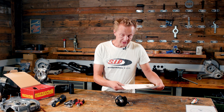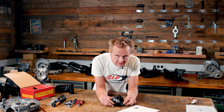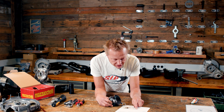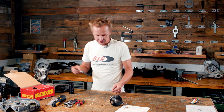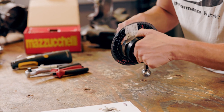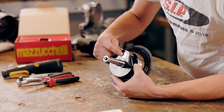If you go on the internet and look for a crankshaft for rotary valve intake of a Vespa, you find such a description as I printed here, and it is already telling you the timing of this crankshaft. Because to be able to compare the different crankshafts, we defined a measurement procedure how to specify the crankshafts. For this we are using our degree disc, and we apply it to the crankshaft web.